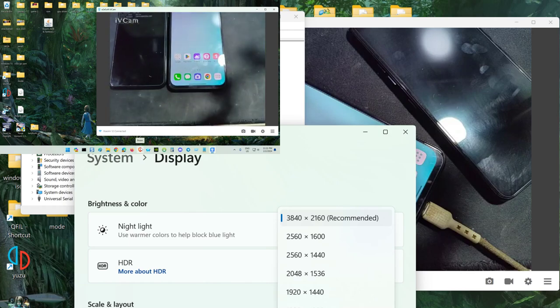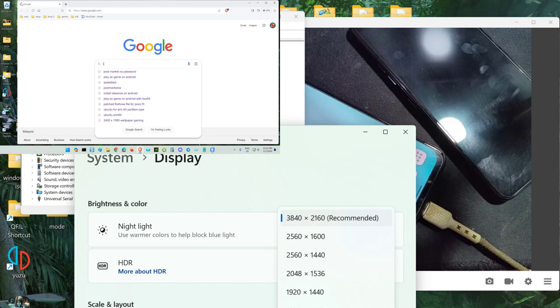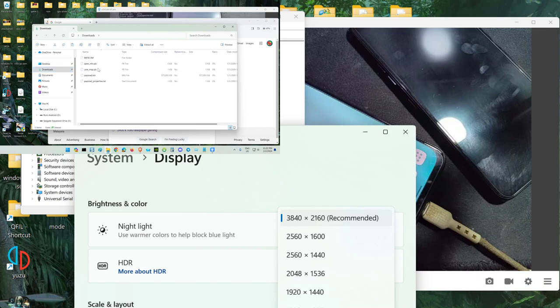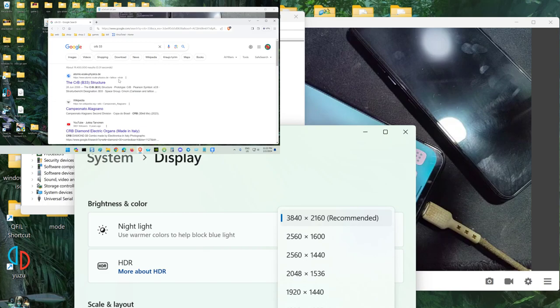Alright. I need a tool to extract the ROM, because I need the boot image from the custom ROM, the ROM that we downloaded just now. LineageOS, because inside the ROM there is no boot image; this ROM is inside another folder. This is a payload folder. Inside here is all the ROM, we need to extract this payload. The tool CRB33, whatever, from XDA.